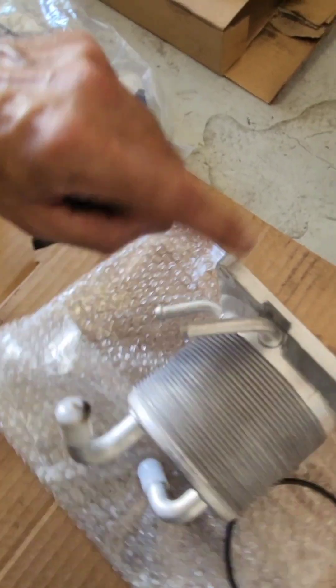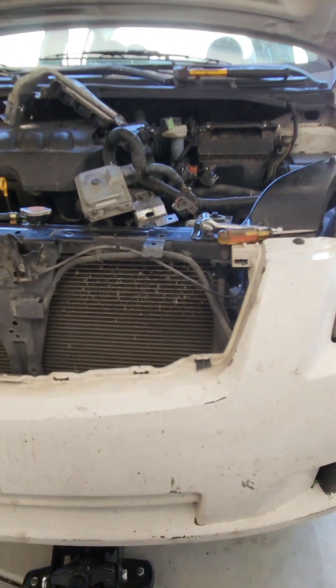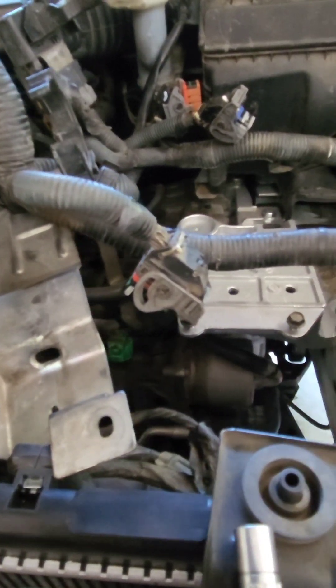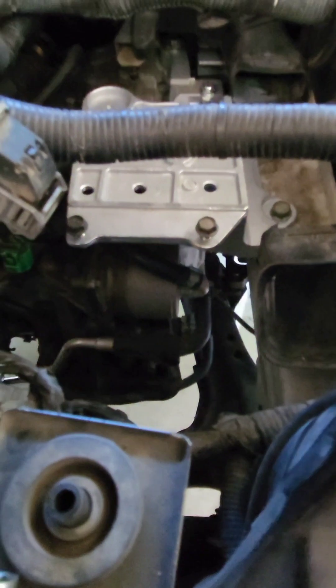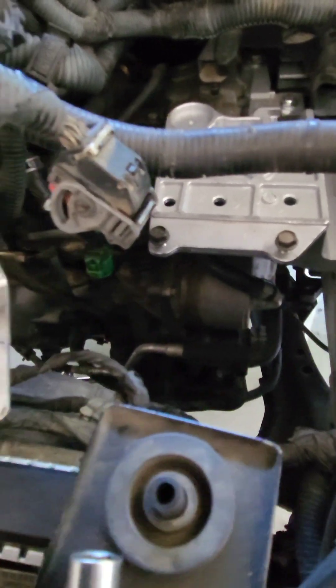Run one line to the lower port and one to the other side, then mount the cooler. This is actually a 2007 Nissan Sentra with a CVT transmission, but the same process goes for pretty much any car with a CVT. Hopefully it's not whining, because if it's whining it's pretty much done. That was the problem with this one — it was whining badly. After anything over about 100 miles of constant driving it would overheat and then go into limp mode.